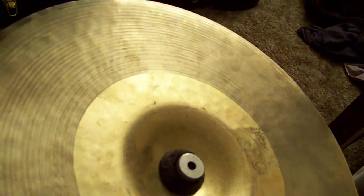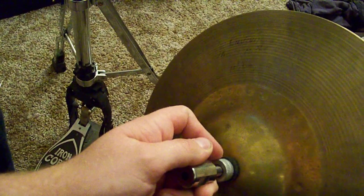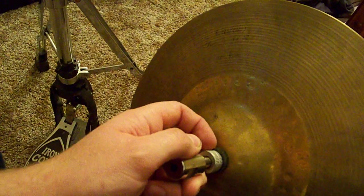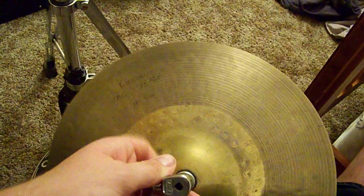If you keep it real loose, you're going to get a different sound than real tight, and it's kind of up to you. I like to keep mine fairly tight so they don't vibrate loose. I like to tighten the bottom one all the way tight, and then adjust up here on this side, so that all of your looseness is controlled by the top one and the bottom is always tight. So with that being said on the clutch, I'm going to go up here and take this off.